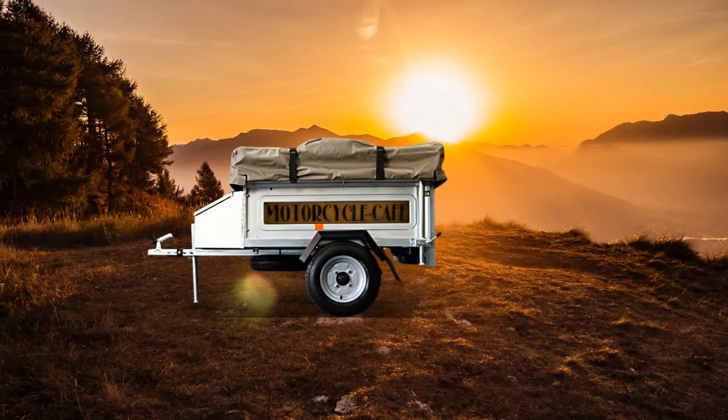They are available in plastic, steel, or aluminium. Underneath your trailer is an ideal place to keep your spare wheel — it takes up no usable room and helps keep the center of gravity low. You can mount it further forward if needed to help get your tongue weight correct. On the sides of your trailer above the axle is a very good place for fuel and water storage — have one on each side, as side-to-side weight distribution is just as important as fore-and-aft. Note how high this trailer is off the ground; if it had a good independent suspension setup, it would significantly lower the whole trailer's center of gravity.